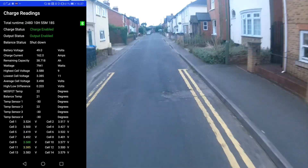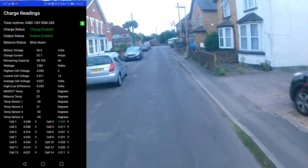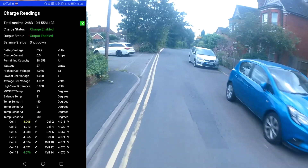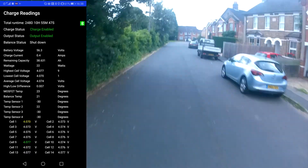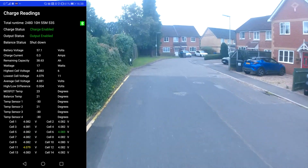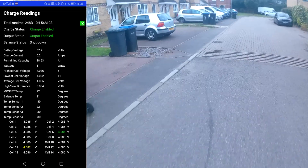God, that is fast! Oh my god, this is what I wanted to create. Blow me out, it's quick — that's got to be nine kilowatts. I've charged the battery up to full and also put a bit more pressure in the tires. Running 25 PSI — I found 30 was too hard and 20 was a little bit soft, so hopefully that's a happy medium.